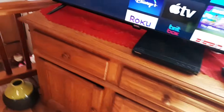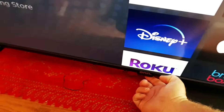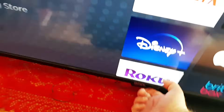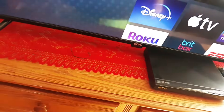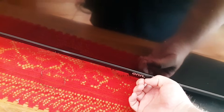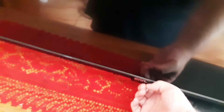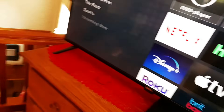If you've tried that, you need to hold the power button down on the Roku TV — it's right below the logo. Hold it for 60 seconds; don't let go for the full 60 seconds. While you're holding it, it's going to power off and then power back on — it might do this three times. Then turn it on and see if the issue is fixed. A lot of times that will fix it.